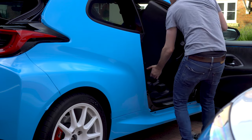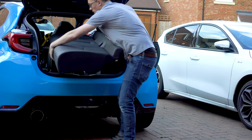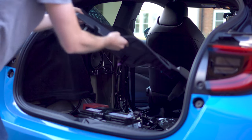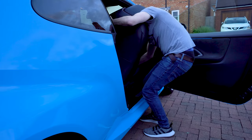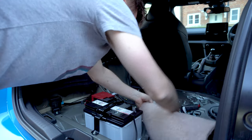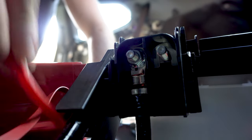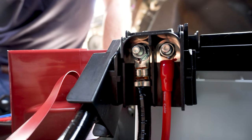The install started by removing everything in the rear of the car: the boot floor, the rear seats, and the plastics. The driver's seat was also removed to make access easier to the cabling underneath. Before starting anything relating to the electrics, it's very important to remove the negative terminal of the battery — I wrapped it in something non-conductive to ensure it definitely doesn't touch the terminal by accident. The first job was to start the wiring for the amp. Luckily there is a free terminal on the battery ready for the amplifier wiring — I just had to supply my own nut.